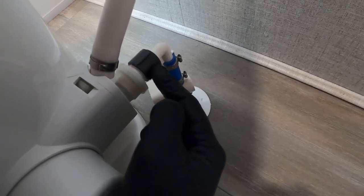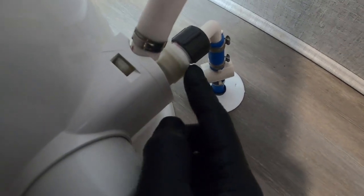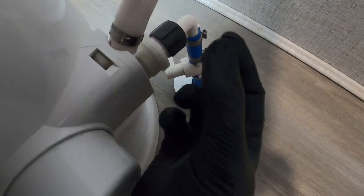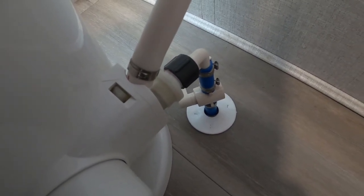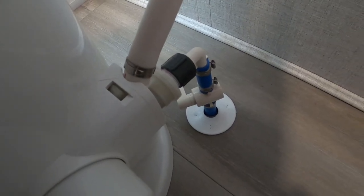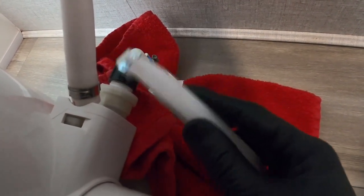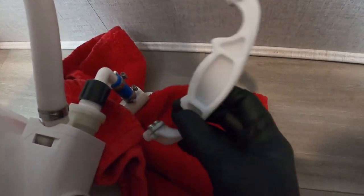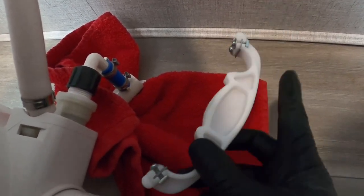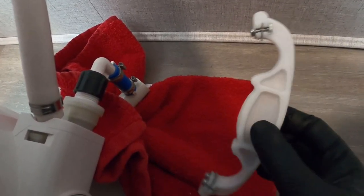First thing I'm going to do is unscrew this - this is our water source. I'll take this off so I can get this valve out. The way you do that is just push down on this little thing right here, and once it disconnects from there that thing will pop right out. This tool comes in quite handy when you're dealing with these plastic fittings because it's not going to wreck your fitting - it just hooks right on the little nubs and then you can unscrew this. I bought this on Amazon for only a few bucks - I'll leave a link in the description. It has one side for bigger fittings and one side for smaller fittings, so it works great for all the plumbing in your RV.